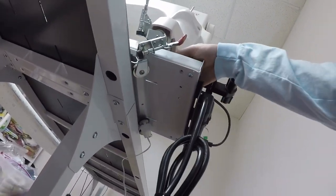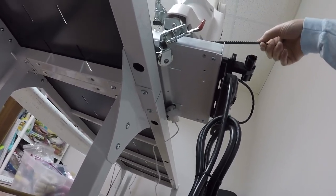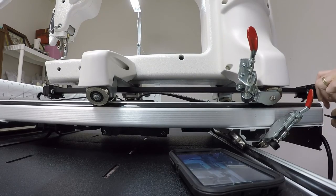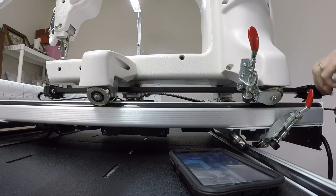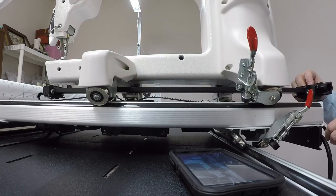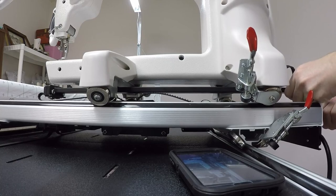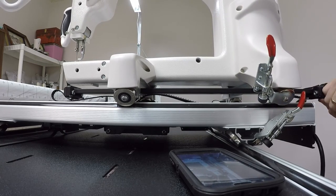So I'm going to pull my belt, making sure it's straight so I don't go through what I just went through. Okay, so this is the straight part of it. I'm going to feed it into this slot. Now there's two things here, one on the left and one on the right. As I'm standing at the back of the machine, the one on the right needs to be loosened enough so that the one on the left will turn freely. And I'm going to take this belt, feed it through the slot into the tensioner. And if I'm doing this correctly, I should be able to, there we go,